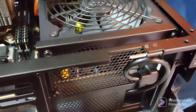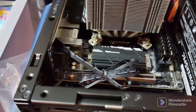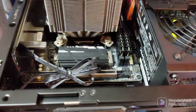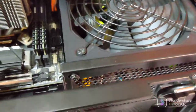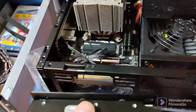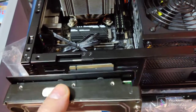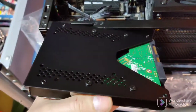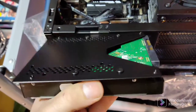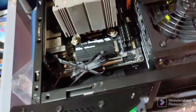You cannot install, instructions say to install power supply, then motherboard. Well, it doesn't work that way. Motherboard first, then power supply. Instructions also say that you can install one of these. Wrong. I used the bracket that it said to use. Got the spacers in there, the screws, all that good junk.